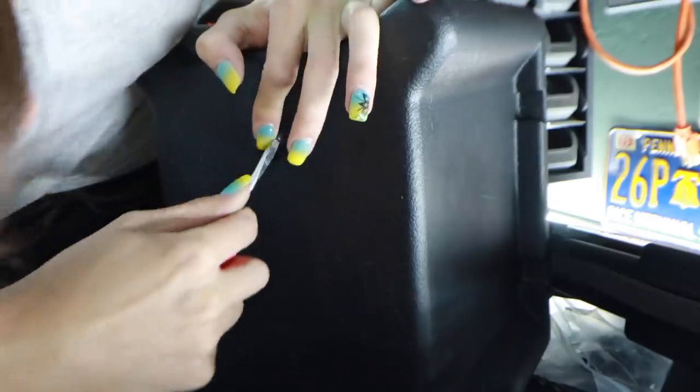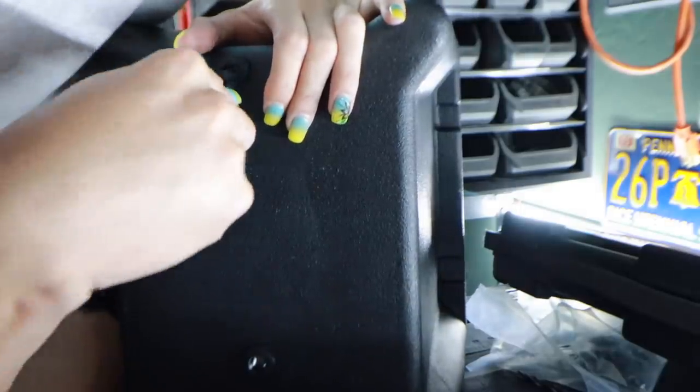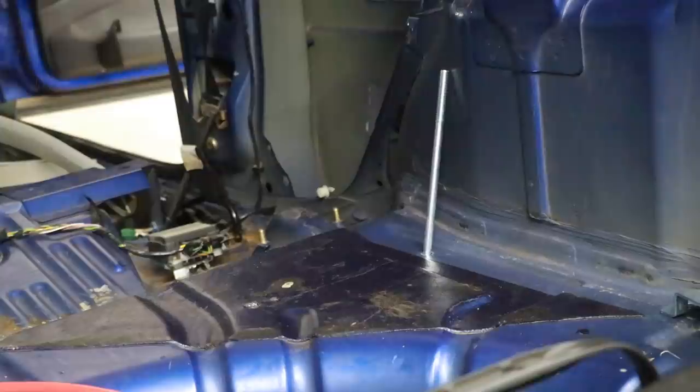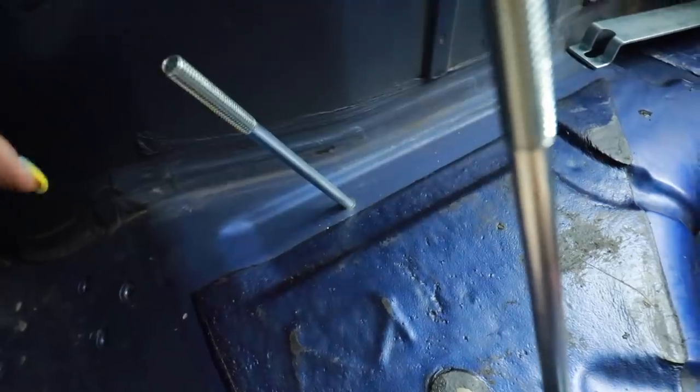There we go, got it. One grommet, two grommet. I ran into a slight dilemma — I can't get a nut on the bottom of one of these because there is a second layer of sheet metal underneath where I drilled that is connected to the rear subframe. This one is good, I got a nut on the bottom of this one, but the other one — if you drop the nut down, it hits. The fix I know to solve this is to use a thread setter gun and put the little thread inserts down inside one of these holes so I have something to thread this stud into.